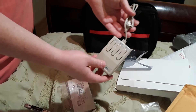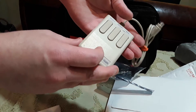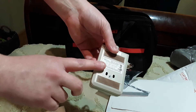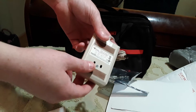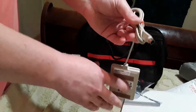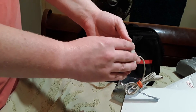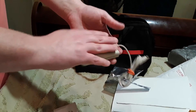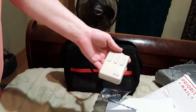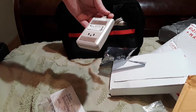It is the pinnacle of mice — a Sun Mouse Systems Type 4 mouse. Three buttons, of course, optical — requires the little metal grid to work on. It's got this 8-pin DIN connector. You can't feel it here, but there's very nice texture on the mouse buttons. Fits the hand perfectly. You might look at that and see this weird wedge shape and think it's going to be uncomfortable. This is very similar to what Mouse Systems had for the PC, of course — that plugged into the RS-232 port.